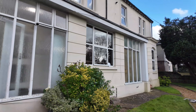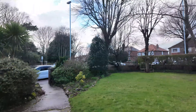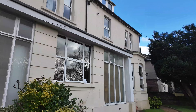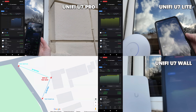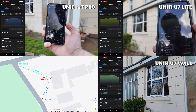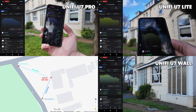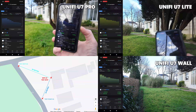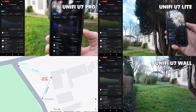The final test used a Wi-Fi 7 Google Pixel phone at 20 and 30 meters outside, accessing each AP one after the other, measuring dBm. At 20 meters the U7 Pro sat at -66 dBm, maintaining a 6 gigahertz 320 megahertz connection at 612/980 Mbps. The U7 Wall used MLO to establish a 2.4 and 5 gigahertz connection at 40 and 80 megahertz — delivering 146/154 and 16/907 Mbps. The U7 Lite at -54 dBm maintained a 5 gigahertz 80 megahertz connection at 680/1080 Mbps.